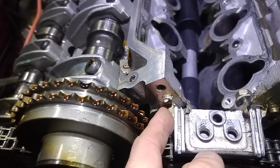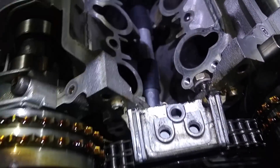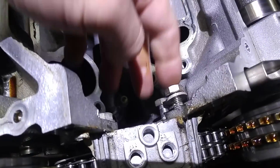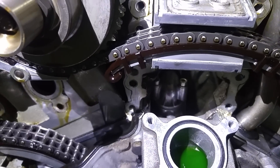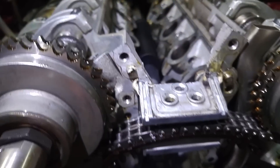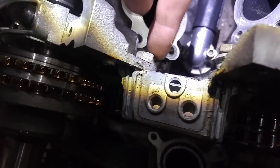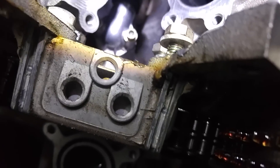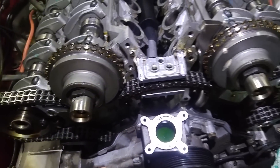The whole case is going to have to be resealed again with new silicone — the black one, Loctite 5900, though Mercedes has its own part number for that. Do not remove these bolts — not necessary. This is where one of the chain guides is installed; it's basically a chain guide bracket. To remove it, you'd have to remove the chain guide. I'm going to run a bit of silicone on the outside as a security measure and reseal these bolts, since there was some white silicone residue on them.